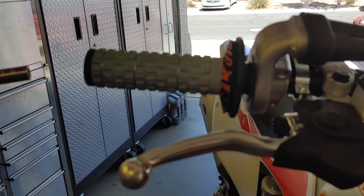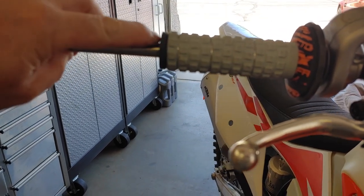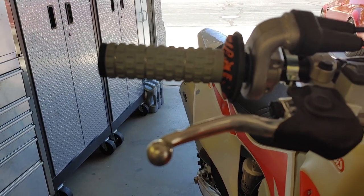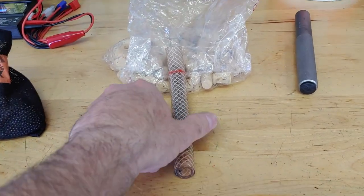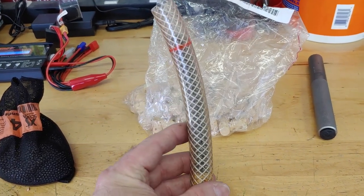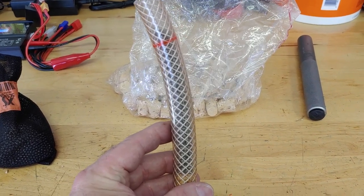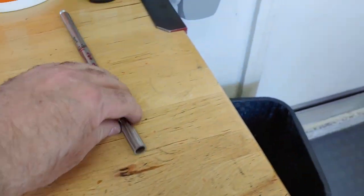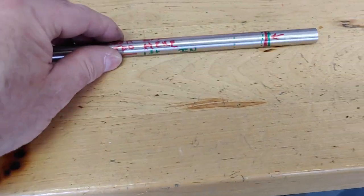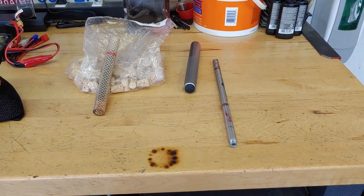Here's with the second cork put in. You'll shove it in that far, which gives me the gap for the Bark Buster mounting hardware. Here's the tube filled up with the lead birdshot — it's measured out. Then I pour that into the end of the handlebar after the first cork is put in. Once this is poured in, I put the second cork in and shove it the length of that remaining rod right there. Then it's done — I just install the Bark Busters and I've got vibration dampeners in the bars.